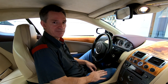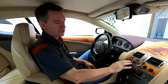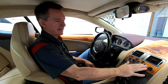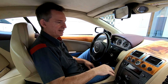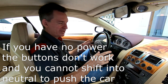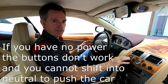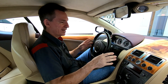One of the fantastic features of the Aston Martin DB9s fitted with an automatic transmission is what Aston calls shift by wire. Essentially there's no gear shift lever here — there are push buttons on the dash where we can select park, reverse, neutral, and drive. But here's the challenge: if you have an electronics issue where the electronics fail, or more commonly if your battery is dead, how do you get your car out of park into neutral so you can be towed or push it out of the garage?